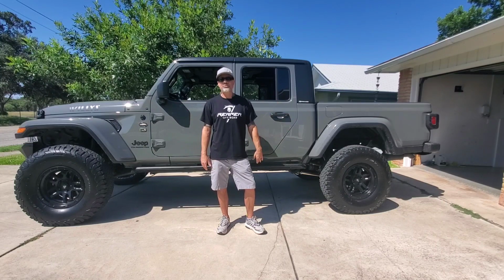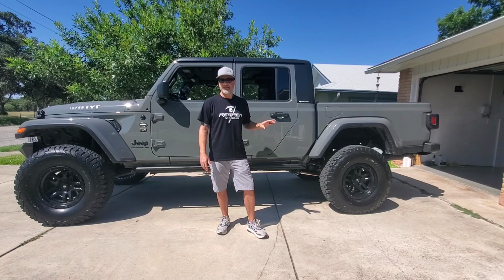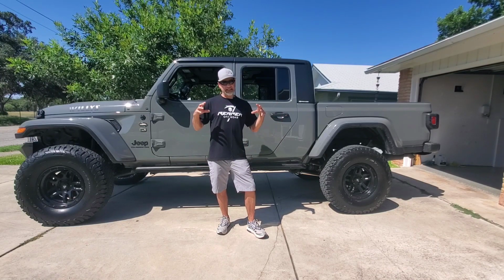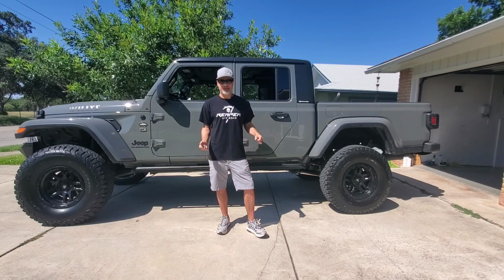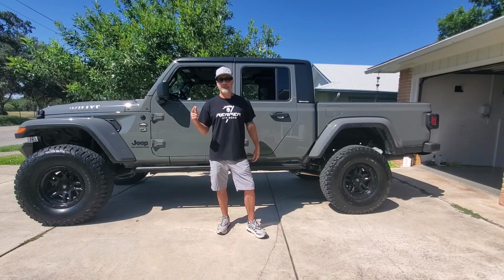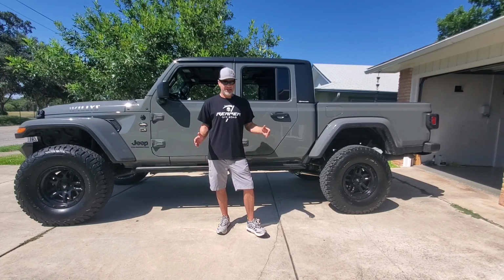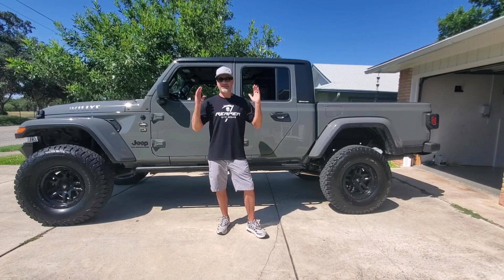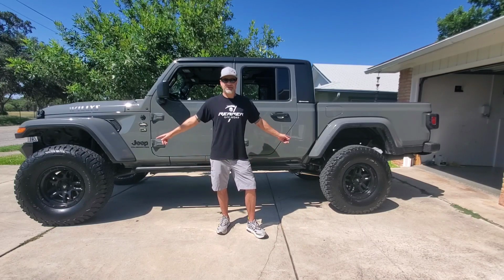When you are off-road with 40-inch tires, there is a big difference in performance and capability than somebody that's running a 37. First of all, that is a lot of rotational weight and mass. And when you're up on the rocks and you try to crank your wheel back and forth, if you're locked on your diff, forget about it. You need Hydrosteer. At a certain point, those 40s are too big. They grip too much. Stock steering is not set up for these big wheels and tires.